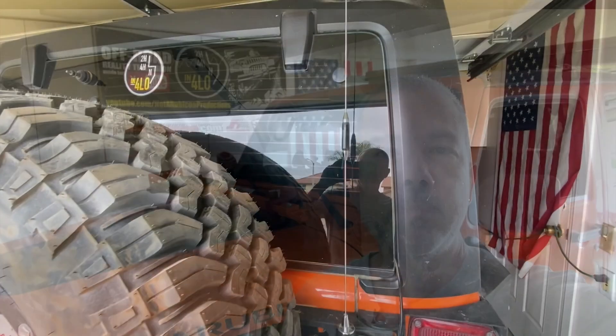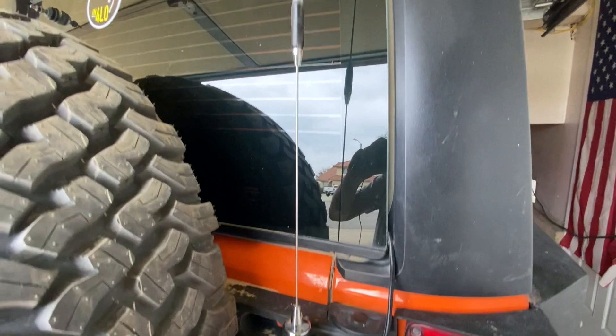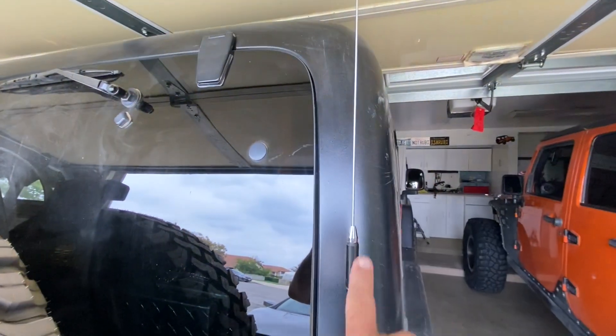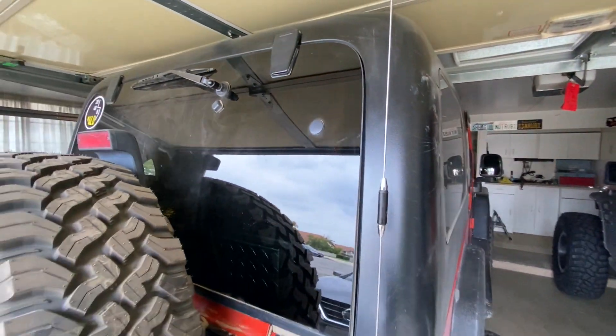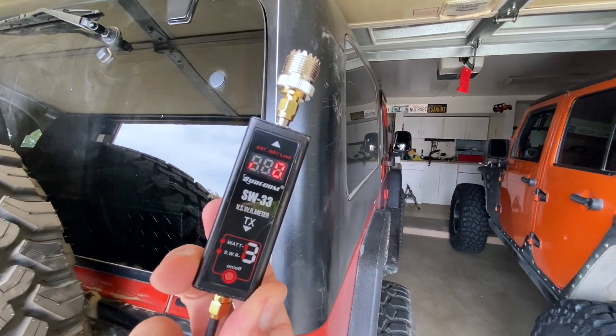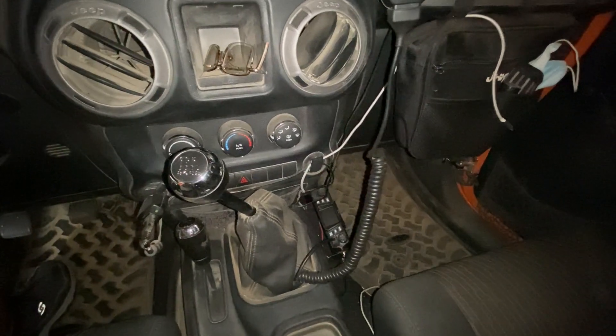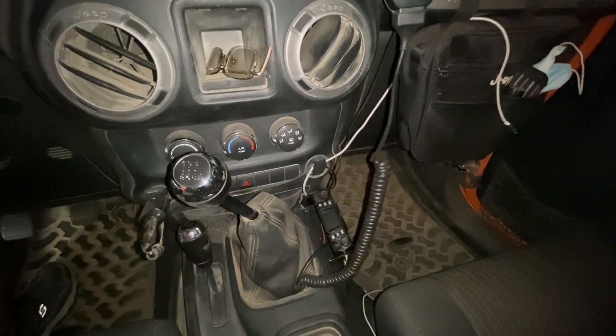We're in the garage today doing some range tests with new GMRS radios. We've got them installed on both Jeeps. Antennas are all tuned and ready to go, so I'm going to go for a drive and see what kind of range we can get. Both Jeeps have Browning BR450 antennas installed. It's very important that you tune these antennas — you actually have to cut them to tune them — so I used my SWR meter, which is about $35. I'll put a link in the description below. We're testing the BTEC GMRS 50X1 radios.